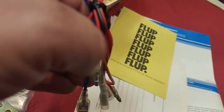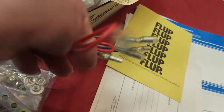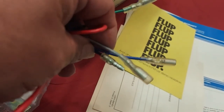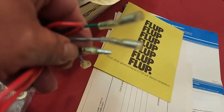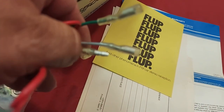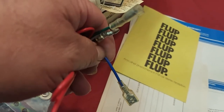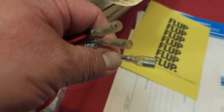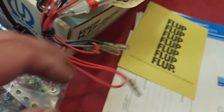There is a black wire here, but this black wire is for the ground of the speakers. These two are the positives for the speakers. This one is the negative for the speakers. And the blue wire is for your antenna — this will be your automatic antenna lead for your power antenna.